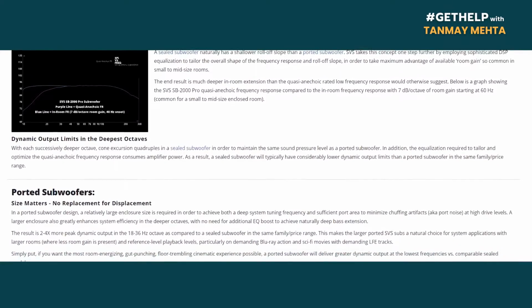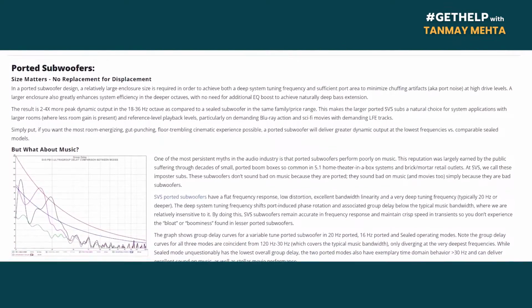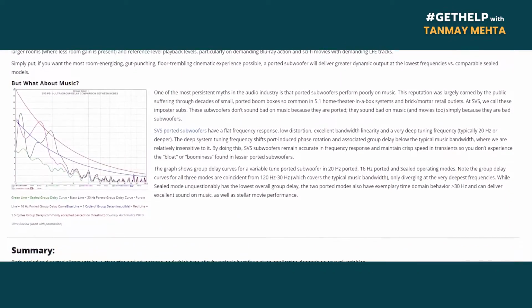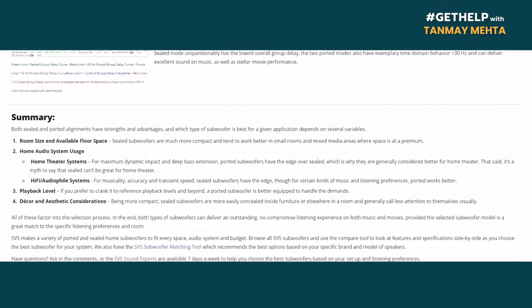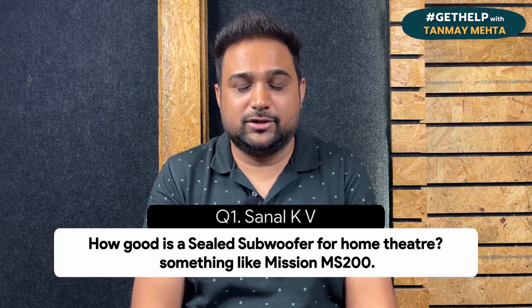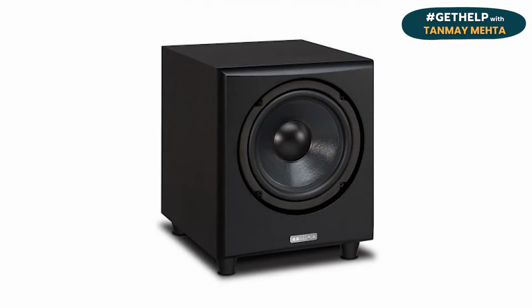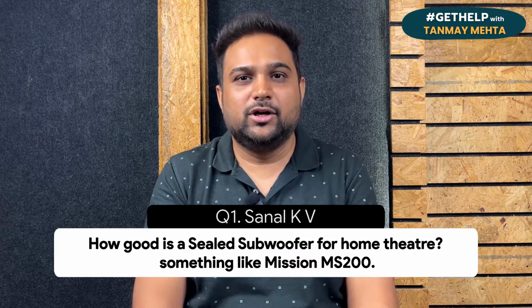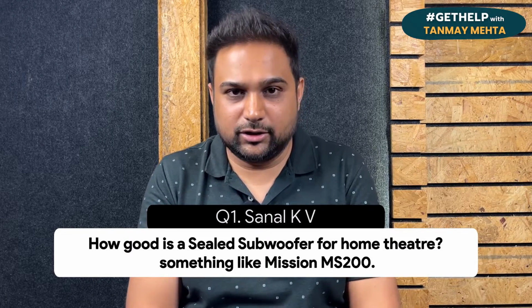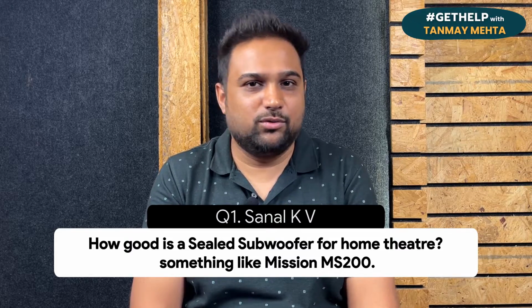Though they are not as powerful as a ported subwoofer, they can still do a job in the home theatre room in case you have got floor standing speakers to pair along with it which are good in bass. If not floor standing, the bookshelf or even your in-wall on-wall speakers, if they have got that bass to cater to your room size, then the sealed box, which is the MS200 subwoofer sealed box, can work fine. Now I don't know the room size, but I am assuming that if the room is around 200-300 square feet, then the MS200 will do a really nice job. So definitely go ahead with it and let us know how the response is.